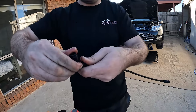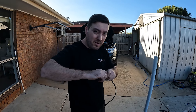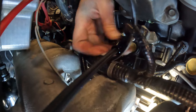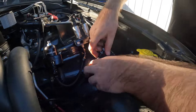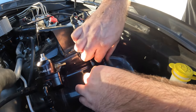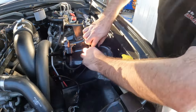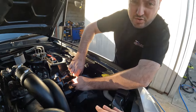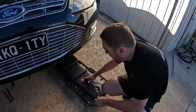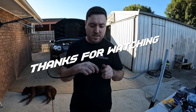When you're at this stage, don't fully tighten the fittings yet. Lock it onto the block side and screw this on so you can still swivel the fitting around. Once you've swivelled it into the position you want, take it off and then lock it down. You can use two spanners or two shifters. So that's the angle we want — tighten it up and it's done. There you have it: braided line, fittings all done.